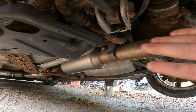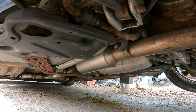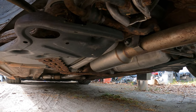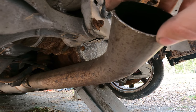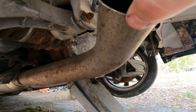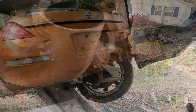You can see the exhaust hangers are leaning forward — it should be back this way. You can see the factory Y up there too, so if I hang on to the car I'll get a three-inch Y, and this is three inches off. The only reason I cut the flange off is because I couldn't unbolt it, so I'll probably cut that flange off and weld it back here so I can change the tip if I ever want to.